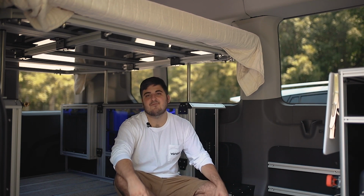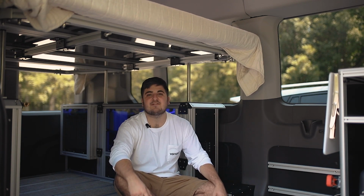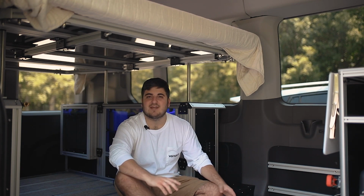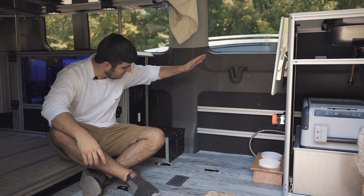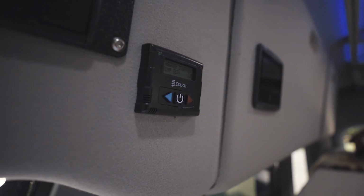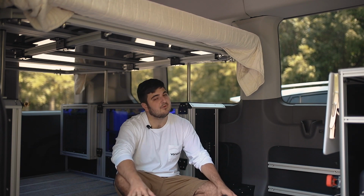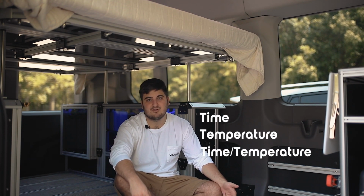At the time of filming this video, we are currently utilizing the Espar Airtronic B4. The furnace operates by sipping fuel off the tank to create heat and then has a DC powered fan, which is low energy draw, to kick that heat into the van. And this is it right here, the Espar furnace. It is controlled via a mounted thermostat on the headliner next to your rocker switches. The thermostat controls the Espar furnace via a couple different variables, including time, temperature, or a combination of the two.